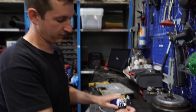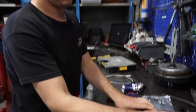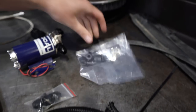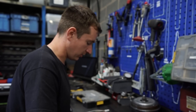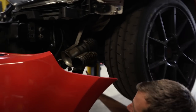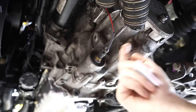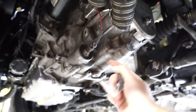Gonna have to modify these fittings a bit and put some Dowty washers on there, no problem. Using this braided pipe, this oil resistant stuff, mounted bobbins, whatever. Then this is the next thing, the weird bit that we're doing. So bulkhead fitting, sorry Danny, I'm skipping about all over. That's gonna go in this bit here, so we're gonna probably put it as low down as we can in this little seal. That should hopefully then get a decent supply of oil through, I'm hoping, but we'll see.